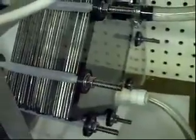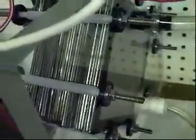Alright, so when we talk about dry cells, we're referring to these type of stacked plate cells where water enters through a bottom hose, floods up in between all the plates, electricity makes the gas and comes out the top hose. So you need a reservoir containing the electrolyte with hoses that connect to the bottom part of the dry cell, and then hoses returning up to the same reservoir to release the gas, and then hoses carrying that gas to whatever you want to do. Alright, so that's out of the way.